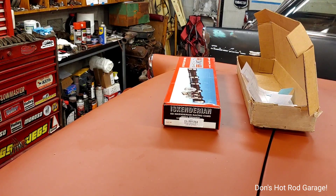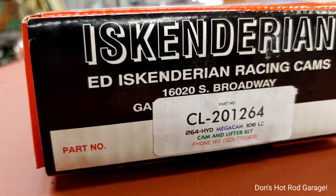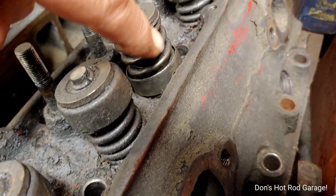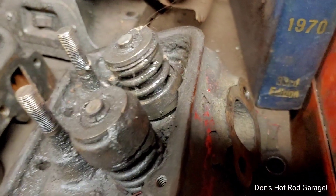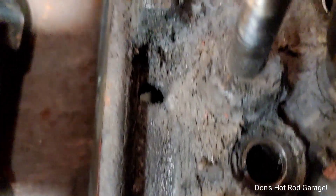I'll show you the valve springs on the heads and then let you guys get back to your evening. Here's the part number — cam and lifter kit. I think it came from Gardena, California. These heads are just filthy inside so they're going to have to be hot tanked. You can see this spring right here is more shiny than the rest because the retainer has come apart on it, and that one as well. We'll replace all of them. I also need to ask about where the push rods go through — those holes look pretty opened up, but I don't know on a newer small block like a camel hump head if these holes were even more oblong.